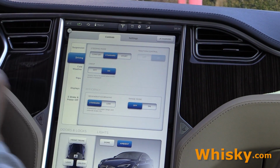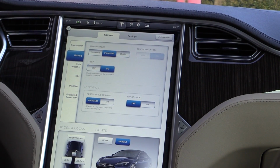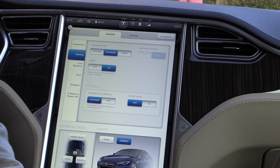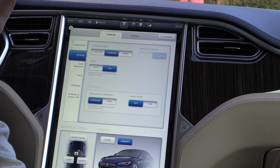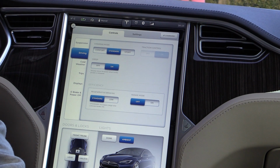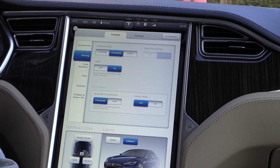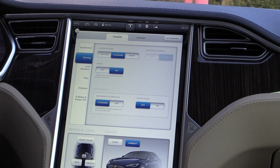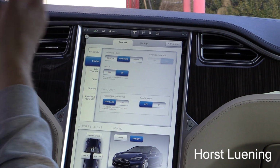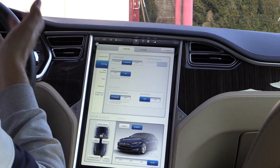If you turn to low, this is, yes, conserving more energy. You're sailing because you're losing three times. You take the energy out of the battery, then you generate, put it in the battery, and then you take it out of the battery again. And all those three factors have a yield. So you lose a lot of energy if you are regenerating. So we say 10% you lose on every action, so 70% you will regain.